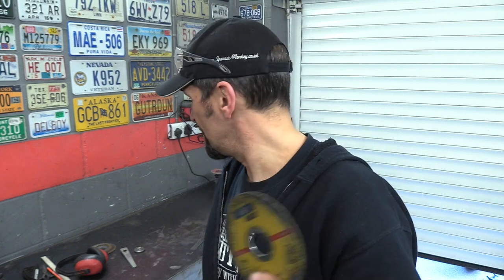But even then, with cutting discs, don't lean on them. It's very important. These particular discs, in these particular grinders, are spinning at silly speed. And when you're pushing them through a piece of metal, well, actually, you're not. Don't push them. Let them go through on their own. Like the metalwork teacher said to you when you were 14 years old in school with a hacksaw, let the blade do the cutting. So as the disc is cutting along the line, just let it go gently.